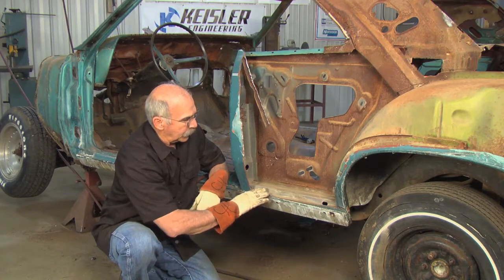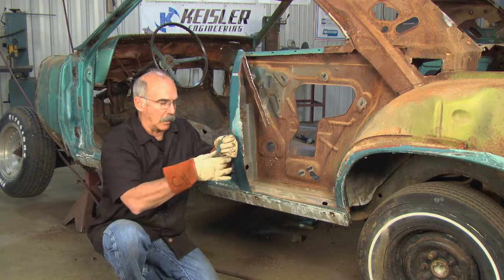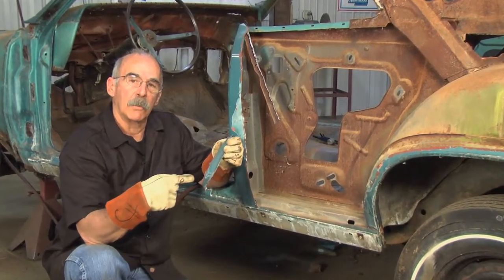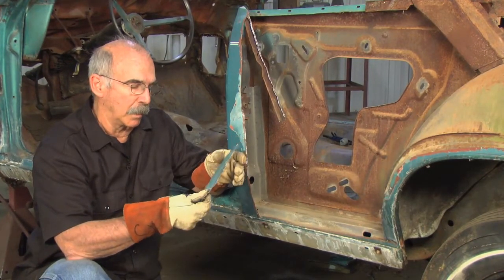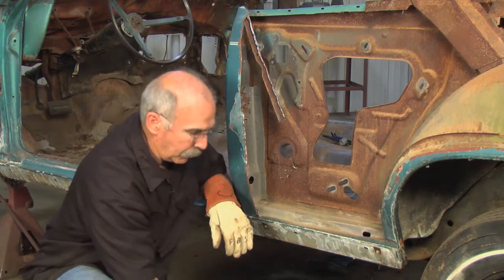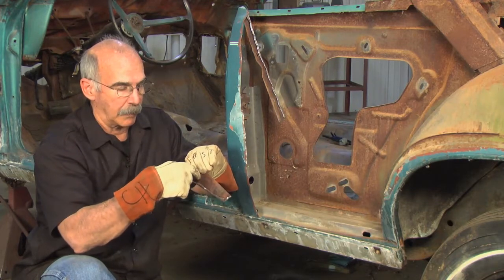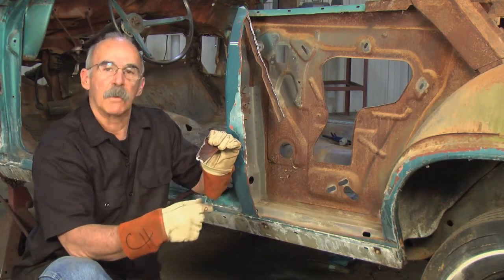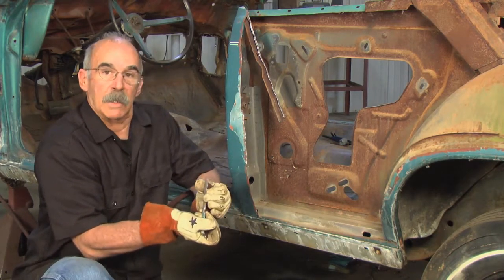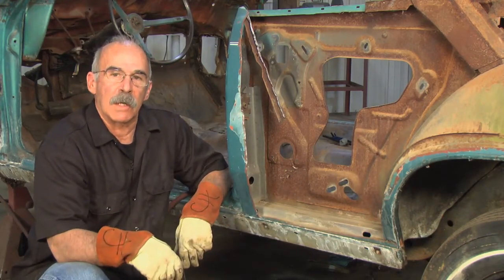What I like to do is take off the metal so I wind up with one single plane of metal to get the spot welds out. The reason is when I bring the chisel up to the spot weld, it's pretty simple to bend this metal. But if you have metal that still has a flange in it with the spot welds, when you're trying to lift the metal with the chisel, you can't hardly bend it — it just fights with the chisel.